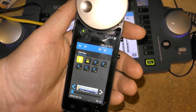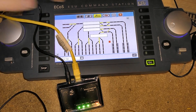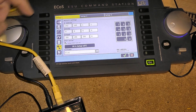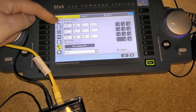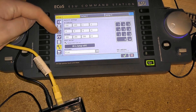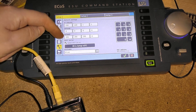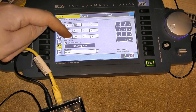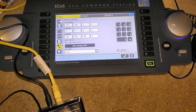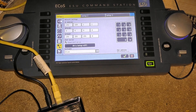I'm not quite sure what I did wrong, but I'll explain what needs to be done. You press your settings, then your IP settings. Then you need to set an IP address — in my case I've done 192.168.1.1. Then you need to put a net mask of 255.255.255.0. Then you need to turn on the DHCP server, and then press OK and set up Wi-Fi. For some reason 'OK and set up Wi-Fi' didn't actually work correctly for me, but I left it running for a few minutes and managed to connect my controller.